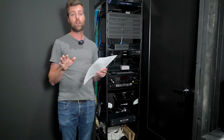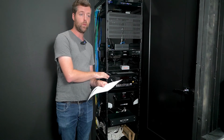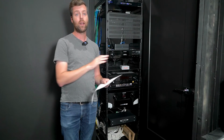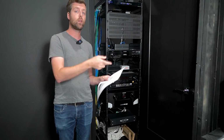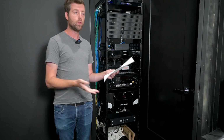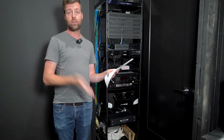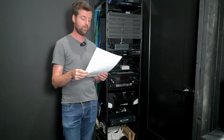In fact, one of the things I'll just mention while talking about that is that mine is plugged into RJ45. The Juke device itself has been completely bulletproof in that regard. However, because I am using AirPlay and I am using it outside, if I walk too far away from the house and I have my phone in my pocket, the sound stops. It's one of the negatives of using AirPlay as your source. One of the easy solutions is just don't use your phone as the source. Use another device like an iPad or a computer.